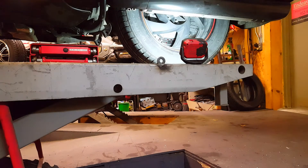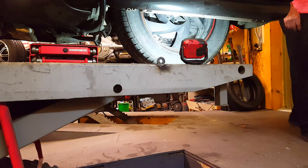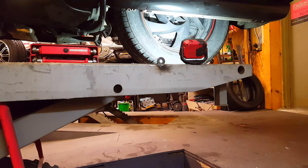Tire's on, inflated, and as you can see it sits just fine. The tire I'm using is a Federal tire — a 195-60-16. That's about the largest tire I can get on the Wing. What's nice about this is the diameter of the tire is slightly larger than the stock tire, so the speedometer is right on the money. Typically the speedometer on the Gold Wings are off by about 3 or 4 miles at 60 — this will bring it right to the money. It's a standard radial car tire.